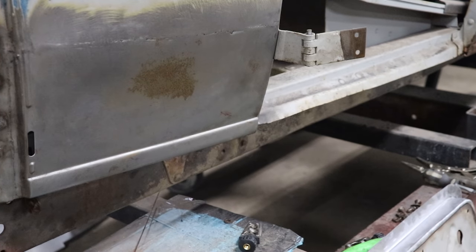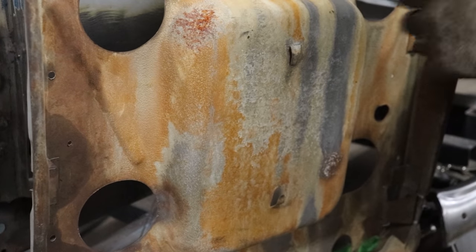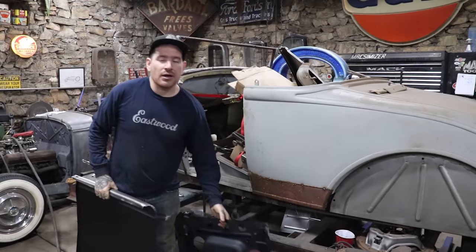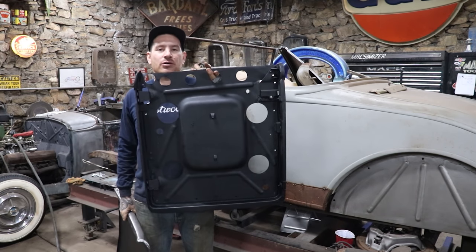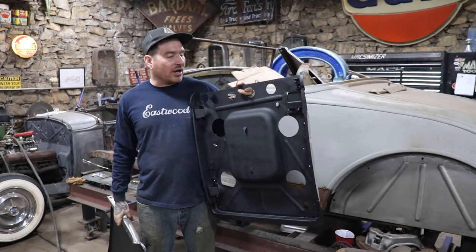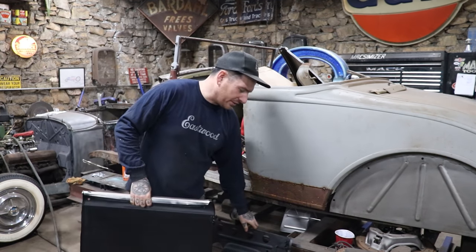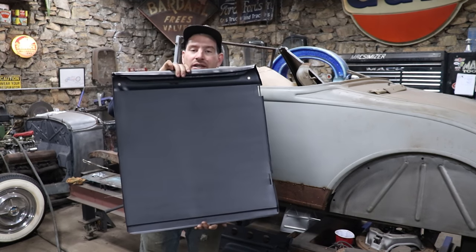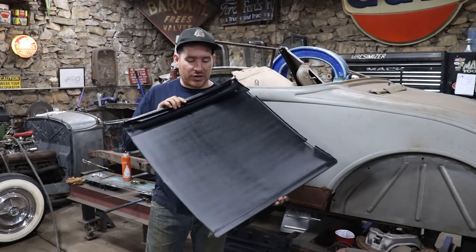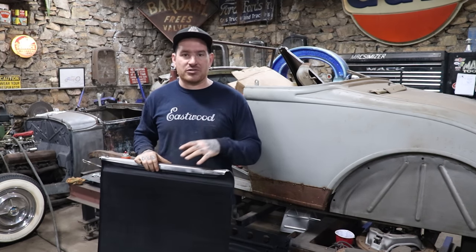So now we can start painting up the rest of this inner structure here. I'm going to clean it all up with a wire wheel and then spray it with some rust encapsulator to get it all sealed up, both inside and outside. Then we're ready to start skinning it. So I went ahead and painted the whole inner structure that we're going to be closing up with some textured Eastwood rust encapsulator. I like using the textured on something like this because it's a little tougher and it will obviously seal up the rust. I also went ahead and did the inside of the door skin - sanded it all down with 80 grit and then sprayed it with the textured rust encapsulator. Nice thing is you can put it on bare metal or rusted metal, it doesn't really matter. It will seal it all up.